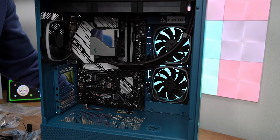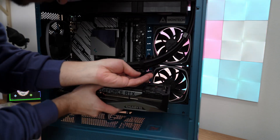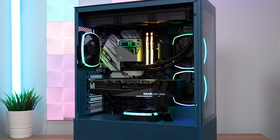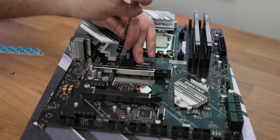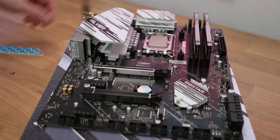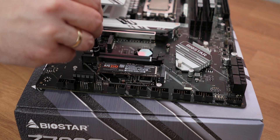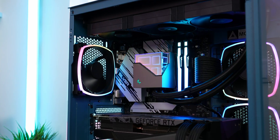It's hard to properly test a motherboard, so this is more an overview than a review. Everything works as it should once the PC is assembled — the VRMs can hold a beefy CPU; a 12900K and a lower-tier i3-12100F were both tested to understand how the board behaves. The CPU never throttled, nothing stuttered, not while gaming, doing productivity tasks, or even under stress testing with AIDA64. NVMe performance is up to supported Gen 4 specs even with all three slots populated. It's worth noting that populating the bottom M.2 slot will disable the second PCIe X16 (Gen 4) slot, but all six SATA ports remain usable. Transfer speeds were at the max capabilities of installed drives — no stutters, no hangs.